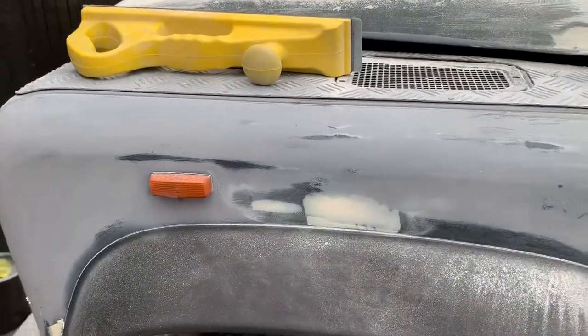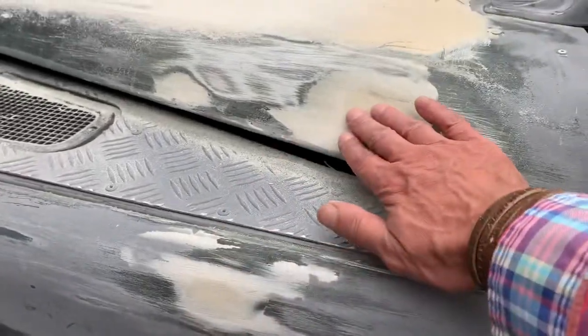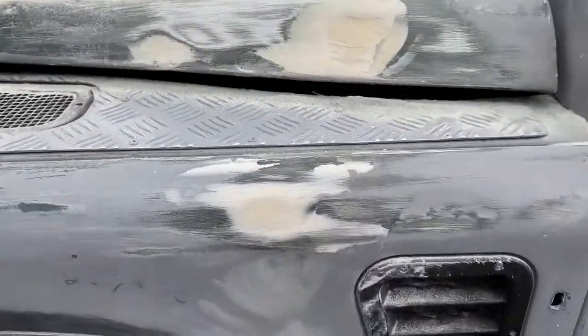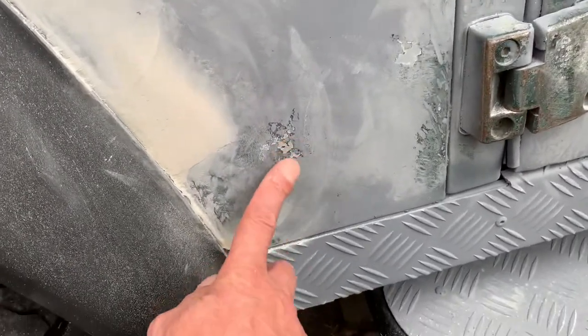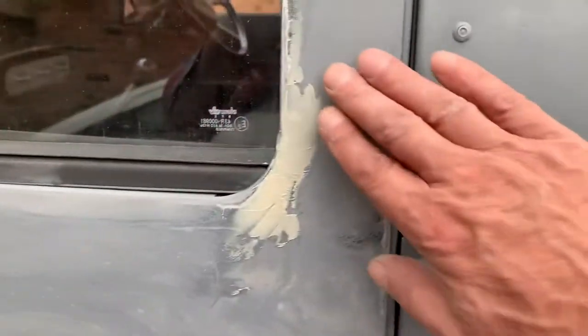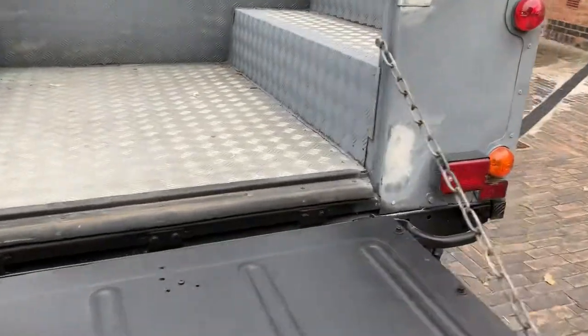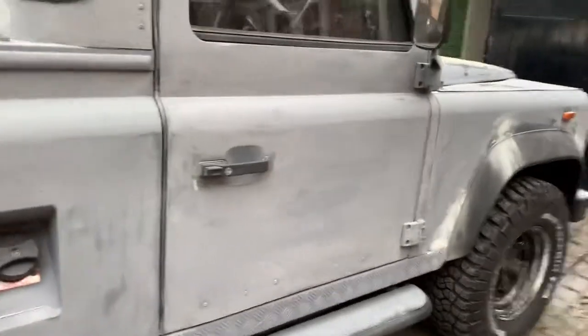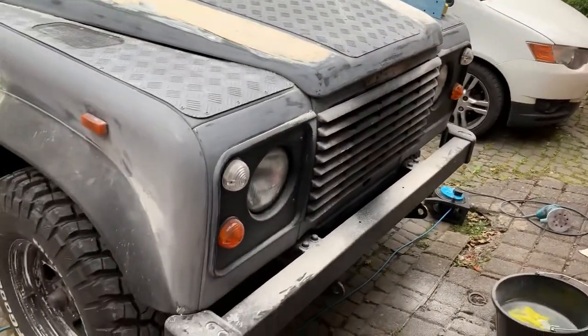This wing's had a couple of little etch marks that we noticed when sanding down. It's now down to 400 which is pretty good — nice and smooth. I've noticed a dent there, a dent there, and a dent there; you notice them as you're going round, it's a bit ridiculous. So some more etching down there, a little bit to do here. We've got to dig that white oxidisation out and fill it. We're in sort of hour 40 of this and we're still filling the body in, which is quite a lot of work. I wouldn't recommend it to anyone unless you know a bit about Land Rovers or love them.